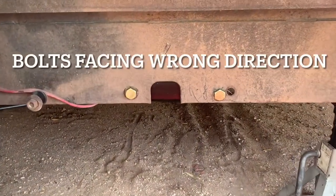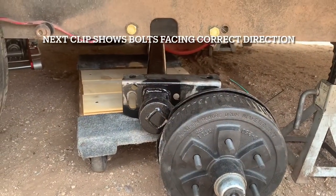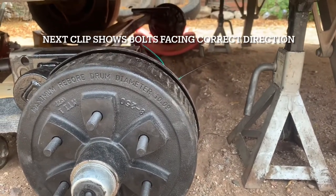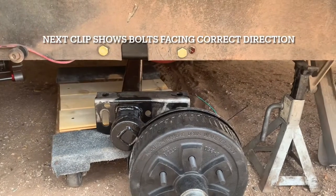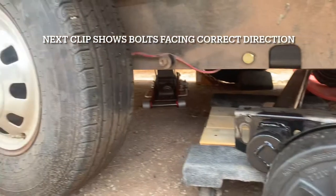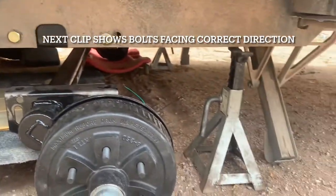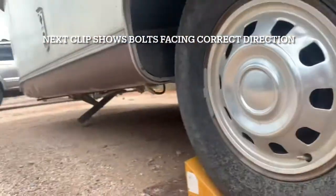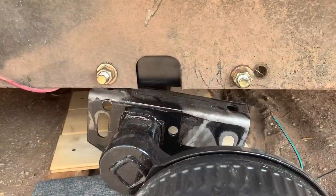The block spacer is installed. Now we have the axle slid underneath there — I just used a rolling cart. My rolling creeper that I've been laying on worked out quite well. We'll put a floor jack underneath the center of the axle. Mind you, we still have the old axle still in place. There's the floor jack just holding that up, and for safety concerns, I have jack stands sitting there with the outriggers out front as well. Safety first, people. Let's read the instructions.